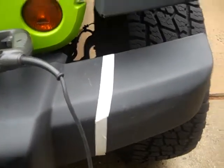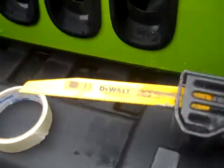So we're back to doing the install of these bumper caps here and turning my factory full width into a stubby. The instructions from Vertical Destinations say to leave 3.5 inches from this mound. I marked that with a marker. Now I've taped it off all the way around, and I'm going to pull out my handy Sawzall. There is a C-shaped piece of steel inside this bumper.